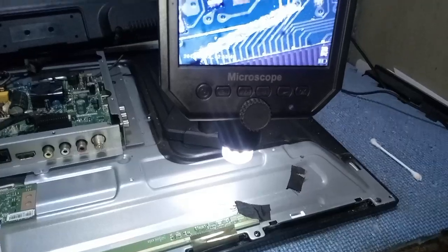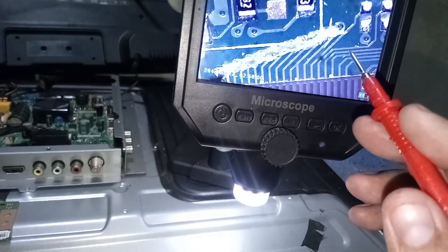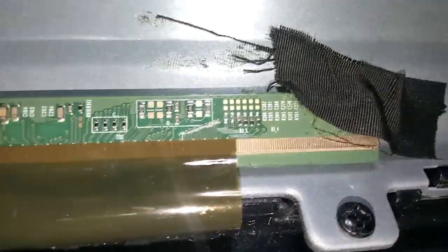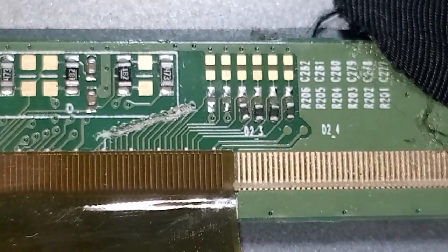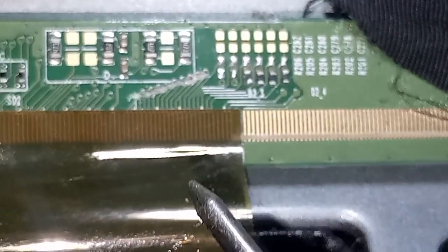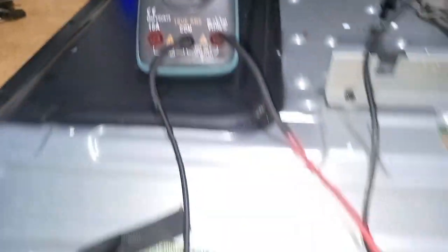To make this video tutorial short, let's go straight to cutting the voltage lines and removing a fusible resistor on the side of the top board where we've seen the burned pixel at the beginning of this video. After cutting and removing, check the VGL voltage. Make sure that the voltage is stable. If it's not, check once again the line that was cut — cut it well.